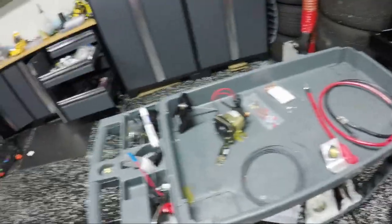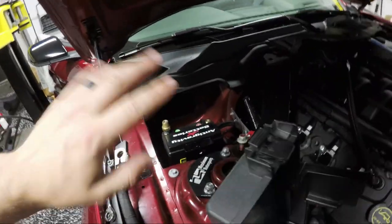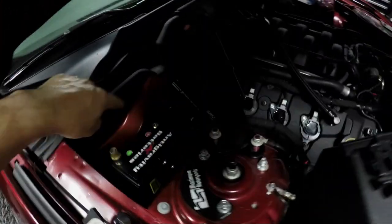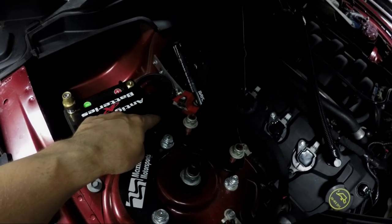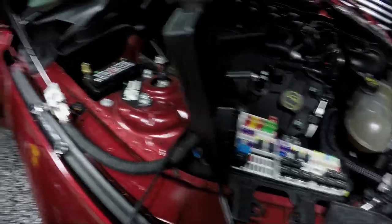My install will be different from yours because I have a weird battery setup. When I was going to install the battery for the first time, I couldn't use the firewall because there's a vent there that pulls air into the car for the HVAC system. So I have a battery sitting right here with a Peterson breather can there. My system is going to run the main cable off here and go straight down to right in there where my finger's pointing — I'll put that little distribution bracket, run a cable from that to the solenoid, and then run power to the necessary areas.